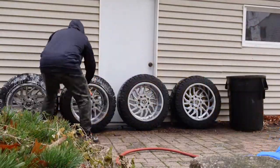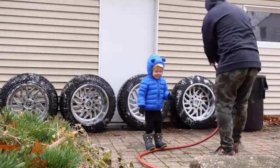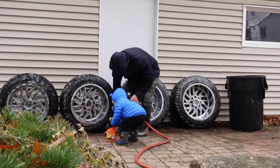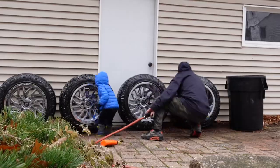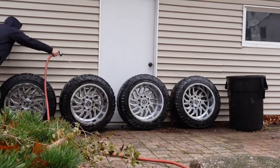We are taking a look at my new wheels for my truck. I'm freaking jacked — I've been stoked for getting these for quite a while. As some of you know, I was riding on chrome wheels before: 20 by 12 TIS 544s, negative 44 offset, running two inch wheel spacers on top of that — so basically 14 wide. Ran those for about a year. I did have to cut my bumper and leveling kit on the truck just to make them fit, and they still rode kind of rough and were super hard to turn, not very practical. Grew to hate them over time honestly, and couldn't wait to get rid of them.